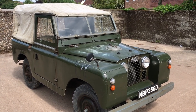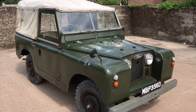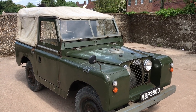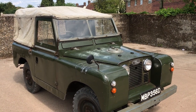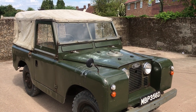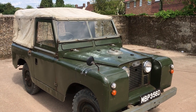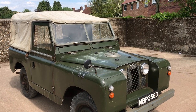Both myself and my mechanic have been all over it. It's really quite amazing in terms of its chassis condition. The chassis has obviously been oiled, probably Z-barted as well given there's a couple of rubber bungs in the chassis from new, but it's absolutely exceptional. Seems to be totally original. The previous owner has done some light recommissioning including all new copper brake pipes and wheel cylinders, and I see he's also fitted a new fuel pump.